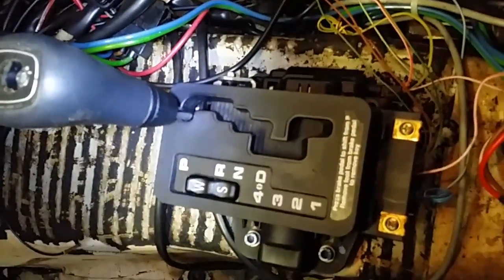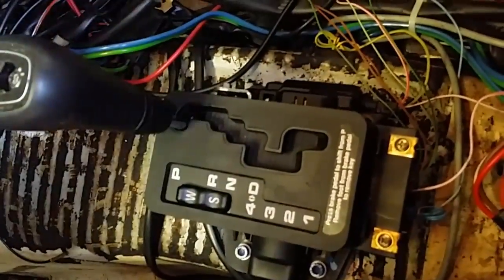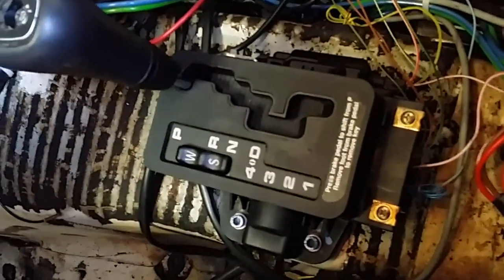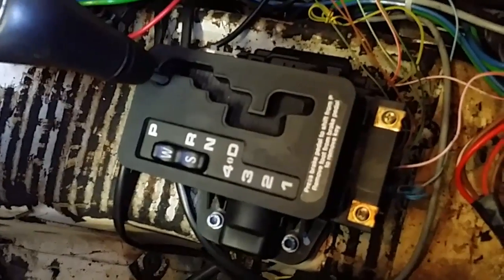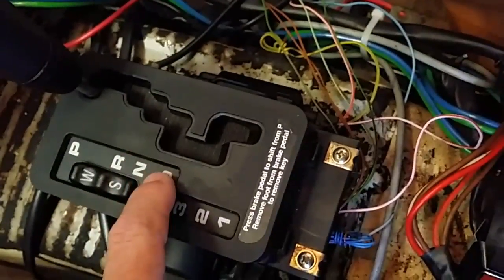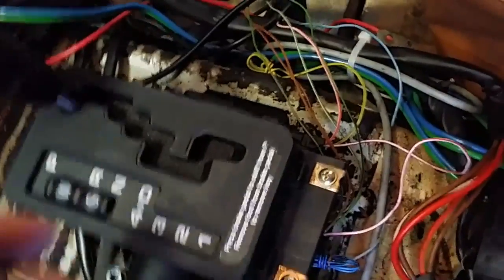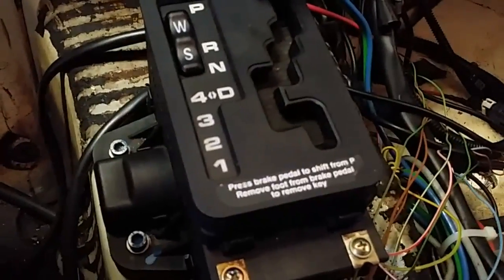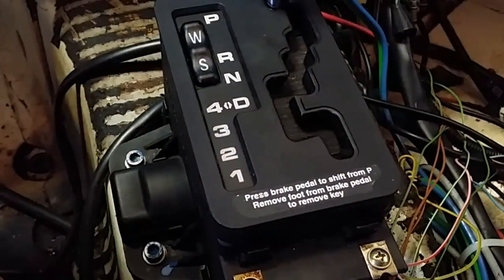Here I have another shifter — definitely not a 123. This car is a 123 chassis, so I got this out of a 320. I had to buy this electronic control unit in the shifter. This is the indicator, and underneath is a sensor where the wires came out of, because it was sending the wrong signal and would not always detect when it was in drive, fourth, third, second — and I couldn't even get to first.